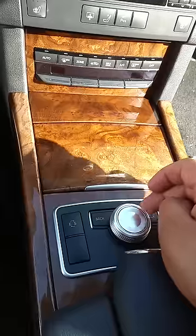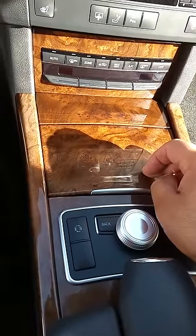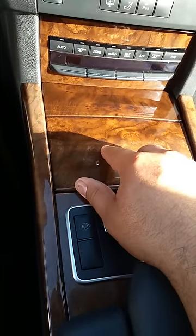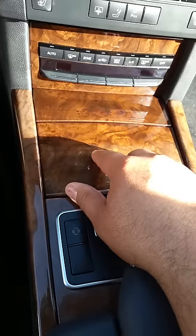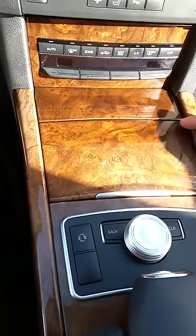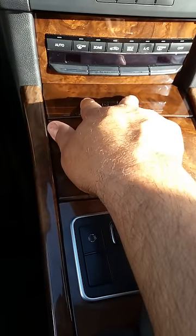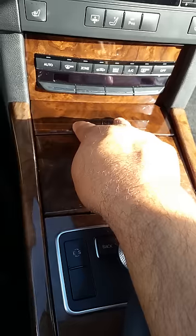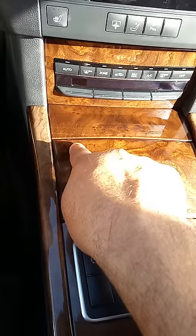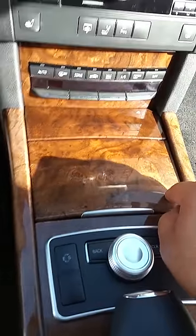The second reason is that there are no videos addressing how to fix the ashtray/cup holder console. What happened with mine is that after the dealer fixed the knob, they actually broke this — I think they may have dropped it. What happened is this second door wasn't closing because there are two arms on this front door that catch it and pull it down. This door operates on a cantilever, and these two arms are spring-loaded. Because they dropped it, one arm wasn't catching, so the door just slid open.